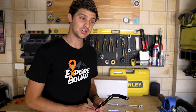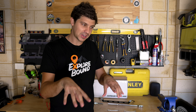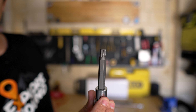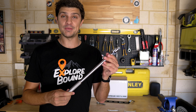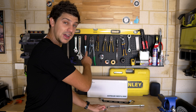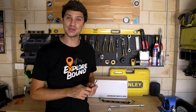The installation should literally be a five minute job with some pretty basic tools. All we need is something to unbolt the two bolts keeping the front seat in the vehicle. For the D-Max they are T-50 torx bolts, so I have a T-50 socket on a breaker bar to give me a bit more leverage because they can be quite tight. To attach the fire extinguisher bracket to the mount I've got a couple of 8mm spanners, but a basic socket set would also get this job done.